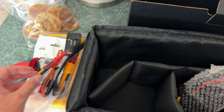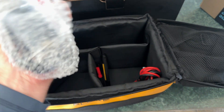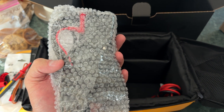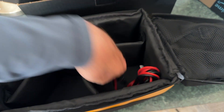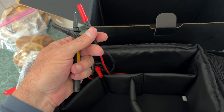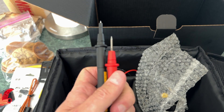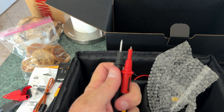There's a strap to go with the magnet too. This is an inductive lead for a tachometer — you can hook it to the spark plug wire if you don't have a tach. And there are more test leads. If you twist this it exposes more of the tip — both the positive and the negative do it.